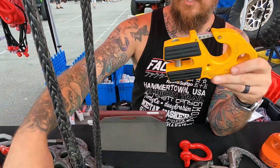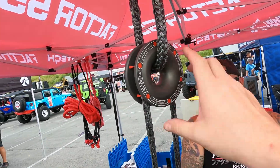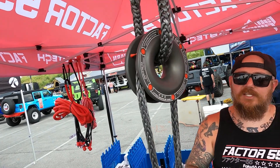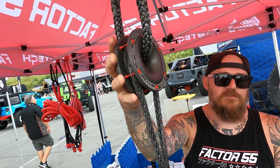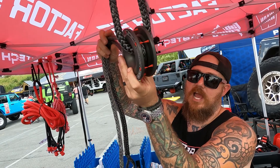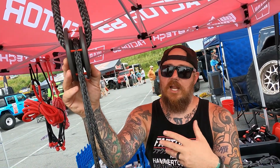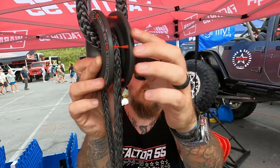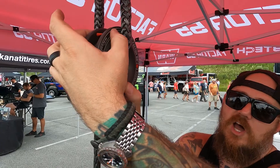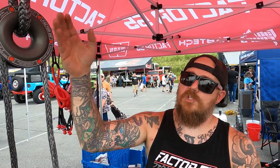You can also upgrade any one of our foldable shackle mounts with our rope guard, which acts as a skid plate to protect the front end of the part as you're nosing into an obstacle. This is our rope retention pulley — it replaces your traditional snatch block. None of the friction rings on the market have our patented feature that allows the rope to spin through the pulley, but when the rope goes slack the rope can't fall out. All our parts are billet machined in Idaho, and this ring has a larger inner radius so it doesn't drag the legs of the soft shackle on the sides, allowing the pulley to spin on the self-lubricating fibers of this ultra high molecular weight polyethylene.